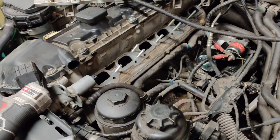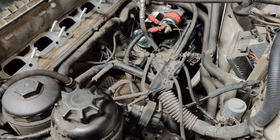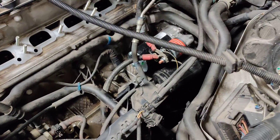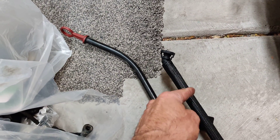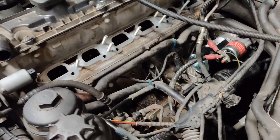Those are the major tips I can give you if you're doing this job, outside of knowing that vacuum stuff. Pay attention when you're taking it apart — if it falls apart, try to piece it back together. Literally what I did was try to piece some of that stuff back together because I had nothing to go off of. The reason I'm even doing this is because the car stopped running and it had a massive oil leak for several months. There was oil just draining down this side of the motor, going down the transmission tunnel, getting onto the cat — when the guy drove it, it smelled terrible. One of those pipes, the one that goes down to the dipstick — on the old one, because this is rubber, it completely just broke and a section of it was missing. So all the oil coming out of this system was just draining right onto the side of the block and running down the car. The other pipes were disintegrating and it finally had such a massive air leak the car stopped running — and that's what precipitated all this.